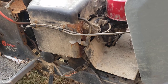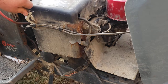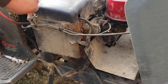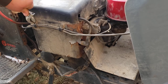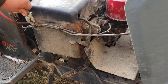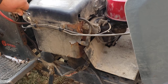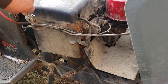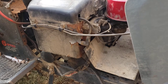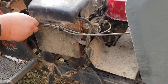Now on the side over here we're going to go ahead and take these loose — we're going to have to anyways to get this out. These are just into the side panels and they're just sheet steel, so if you go too tight with them they'll strip the threads. These ones I'm going to have to take all the way out so I can spread them apart, but that's no big deal, just put it back on where it goes afterwards.